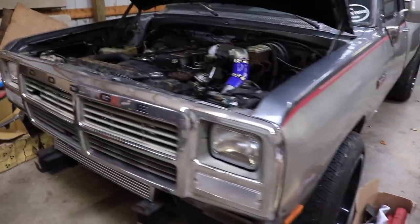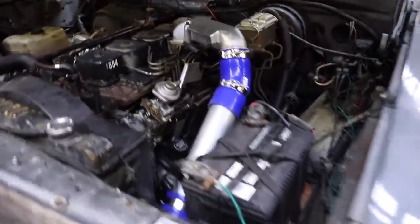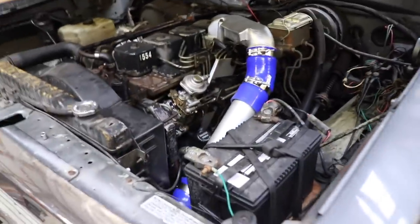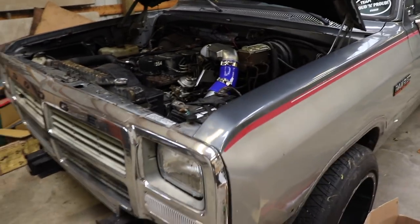Hopefully it goes pretty smooth, but other than that it's starting to piece together little by little. We just need to put in injectors, valve springs, and the governor spring, and then the compound turbos, and then all of our parts are in. Then we're going to move on to the next thing, which is the transmission, and also — not necessarily in that order — the lift pump. We got to upgrade the lift pump to make sure this is going to be getting enough fuel for the power that's going to be put to it.